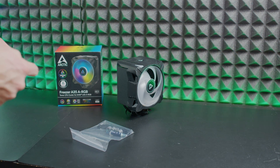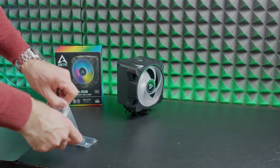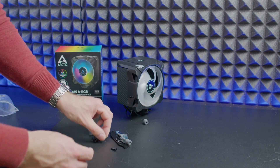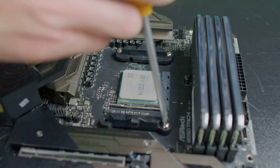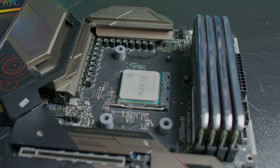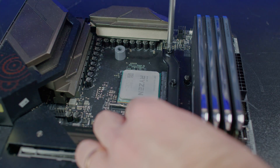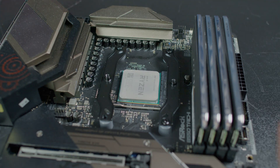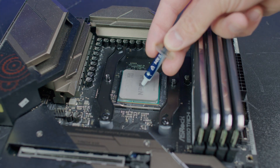The installation is quite easy with no fuss. You get four standoffs and four screws that you place through the standoffs directly to the original backplate of the AMD motherboard. Between the standoffs and screws you place the mounting plates, and then connect the CPU tower cooler. Of course, you need to remove the plastic foil from the cold plate and apply thermal paste as you normally would.